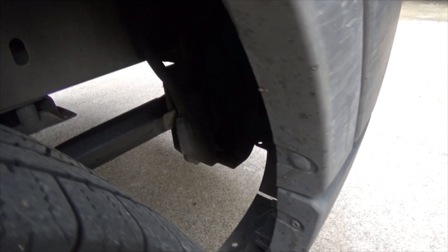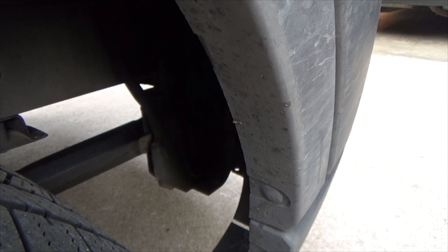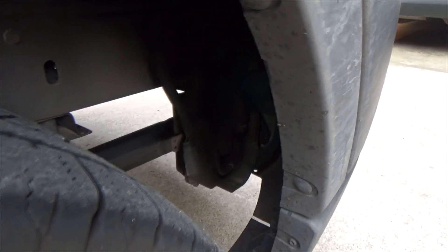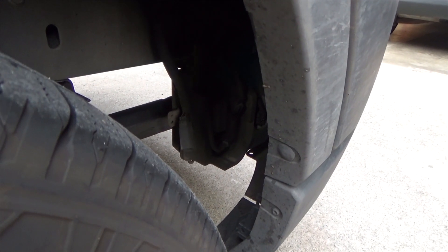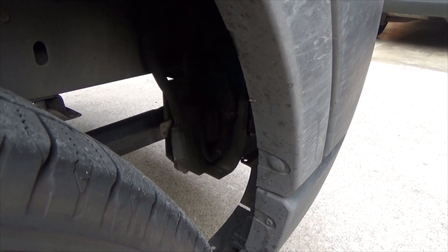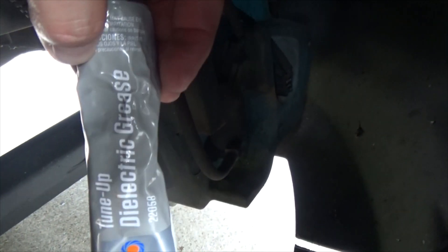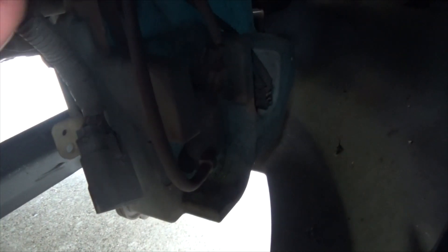I had trouble with my water pump — basically a bad connection on the plug — and I couldn't figure out why for a while. If I used it continuously it was fine, but if I wasn't using it for a day or so on the road it just stopped working. The problem was right here on this connector — all I had to do was disconnect it and put this magical stuff on the terminal.